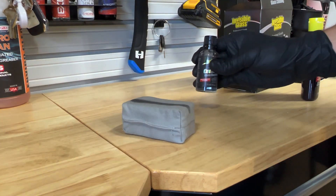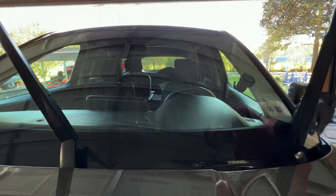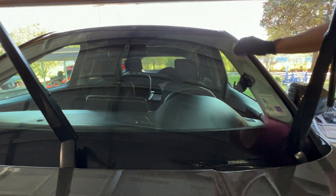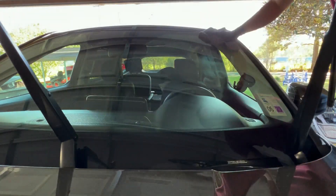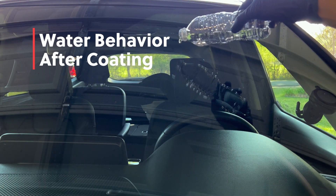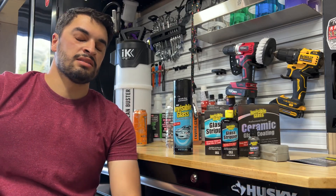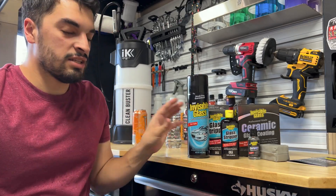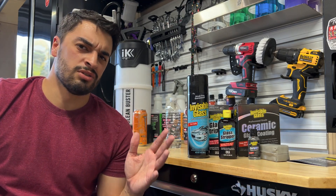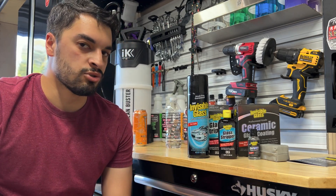Now it's finally time to start applying our ceramic coating. After a heavy priming line to prime our applicator, I'm going to apply a draw line through the middle of the glass, box it out, and then apply in a crosshatch pattern. When it comes time for buff off, in a controlled environment you may have a minute or two before the coating flashes and is ready for wipe off. In my environment it was pretty immediate — it was a pretty hot and humid day, so don't pick a hot humid day to test out a new coating. It did give me a little feedback and was not the easiest coating to buff off, but no high spots that I can see.